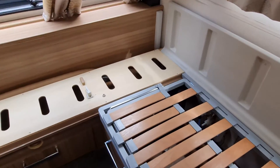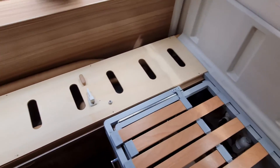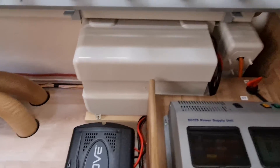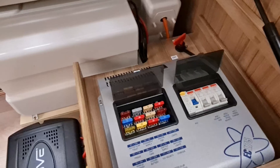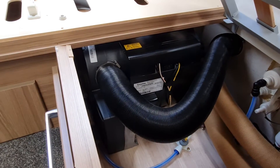For anybody following, hopefully this solves your problem, especially if you're getting a caravan that's getting to the kind of age where the heating elements are wearing out. Watch me and I'll talk you through what I do and give you some feedback at the end. The heater is located under this area here of the seat, which is going to require removing the wooden board at the end to get down to it. First things first — making sure all electrics are switched off, safety first, and making sure any power supply is off. There is also a 12-volt supply to this unit.